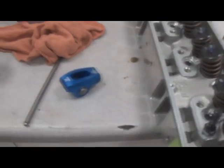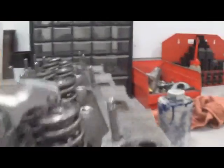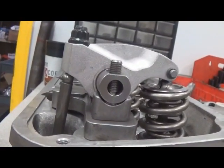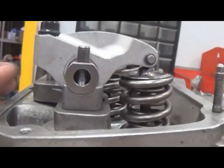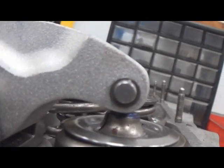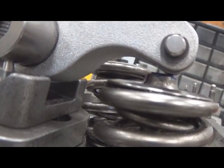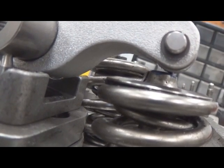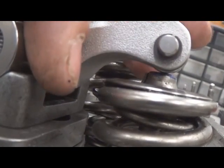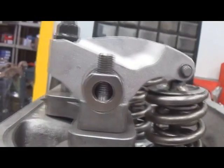Now when you get into a shaft system, the same push rod goes up through the cylinder head, but notice there's no adjuster in the center of the rocker arm — the adjuster is actually at the push rod cup. So rocker arm geometry is determined by the pedestal height. If we lift the back of the rocker arm as if lifting the pedestal, that's how we change the geometry. Rolling up to the exhaust side of the tip tells us we're shimmed too high; moving backwards toward the intake side means we're too low on the pedestal. Push rod length is not determining valve train geometry in this situation.